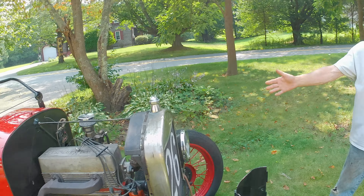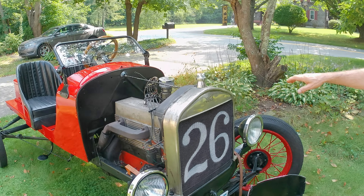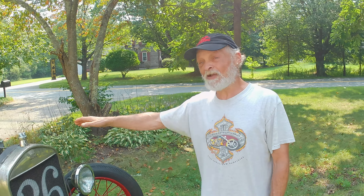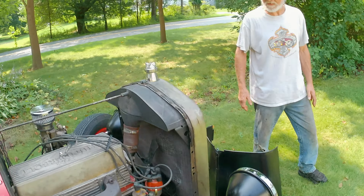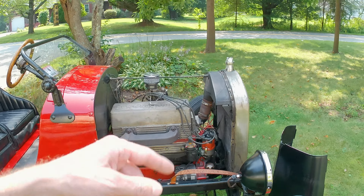It's got all new modern valves. I put the stock 1928 valve springs in it because I didn't want to wear the cam out — soft cam lobes. If I'd put high-performance valve springs in it I would have eaten the cam. Neil did the head for me too, I got it in the box with everything else. He milled the bottom of it, milled everything perfectly — it's unreal.